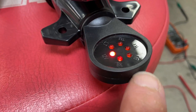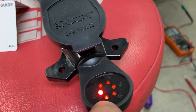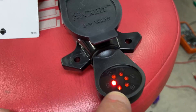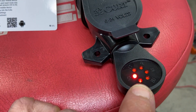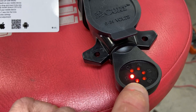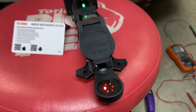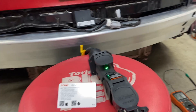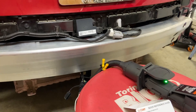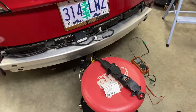This little light right here — the BK — this is your trailer brake. When I hit the button on the phone, this light does illuminate, and the intensity with which it illuminates varies based on my setting for the trailer brake. So this is a very good indication that it's working properly. That kind of wraps up this phase. I'm just going to have to shore all this up, clean up the wiring, reattach the bumper, and then once we get it all back together we'll actually hook up the trailer and give it a try.